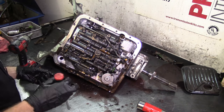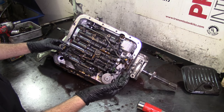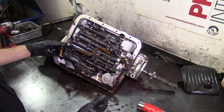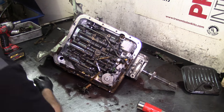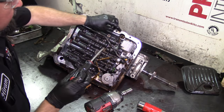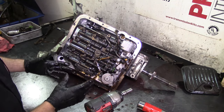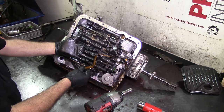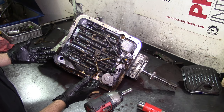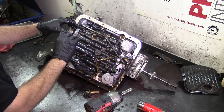Sometimes you're done with your overhaul and you're still having issues — you've installed a shift correction kit whether it be a TransGo, Superior, B&M, or whatever — and you still have problems. Eliminate some check balls and you fix it. The torque converter clutch solenoid has a retaining bracket for the harness, and the pass-through case connector has a tab broken already. 700R4s have issues — missing bolts, things out of place. Some of them do last well if you make sure your throttle cable stays connected.